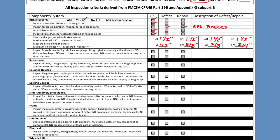Now we go to inspect brake hoses, tubing, airlines, couplings, fittings, glad hands, et cetera. We have to make sure there are no issues. If no repairs were done, you put found okay. But if you replaced the glad hand seals, you write it down — for example, 'replace glad hand seals.' We also have to make sure that we drain the tanks using the cock fitting at the bottom of the air tank. Once we do that and there's no defect, we press okay.